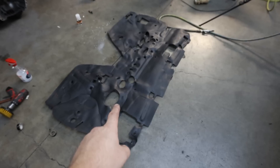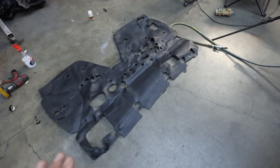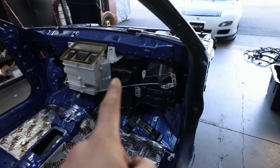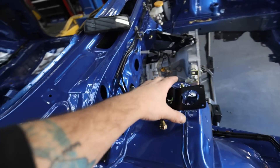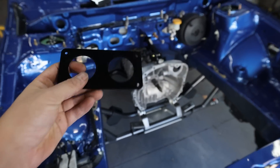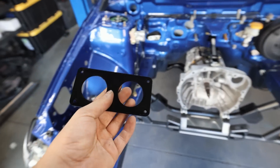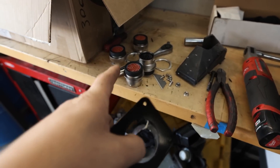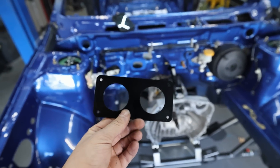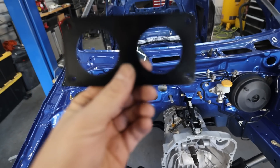I've got the firewall mat all cleaned up, but we need to take out the brake booster and the pedals before we can put it back in — they pass right through it and it does add to the spacing of everything on the firewall. I've got the heater core and blower motor cleaned up and temporarily in because we need to cut the firewall a little for a harness plate. Since we're using a Haltech R3, I'm going to make an engine harness and need breakaway connectors through the firewall. I've checked clearance — we'll use two quick disconnects for our engine harness right about there. Before installing everything, let's get the firewall cut for this and get it drilled in. I'll need a little touch-up paint to clean up the cut, but that's where the old engine harness passed through, so that's where our new one goes.